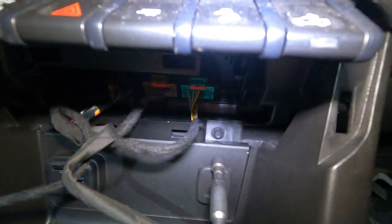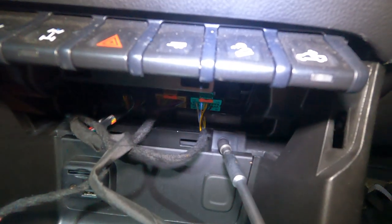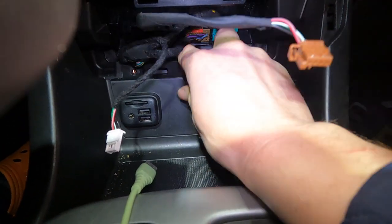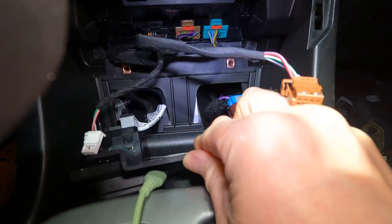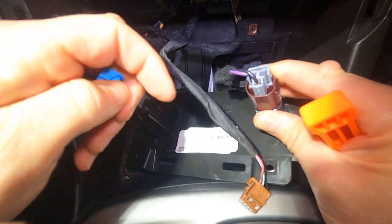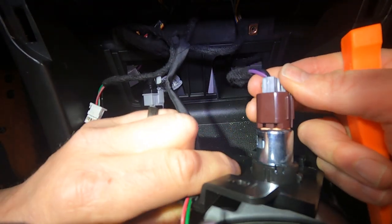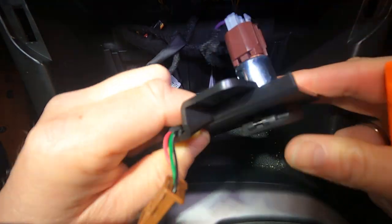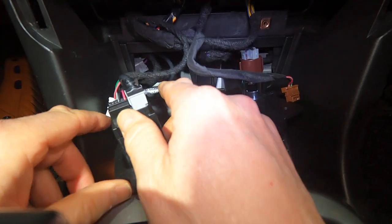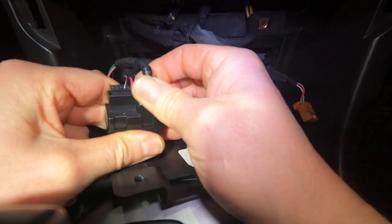Use a 7-millimeter socket to remove this little screw — be sure to save it, put it in a zip-lock bag. Then pop off this little plastic piece, which contains the cigarette lighter and the USB connector. The cigarette lighter was the bane of my existence — this was the hardest thing in this whole entire project. I'm going to show you how I did it. Up next is to remove the plugs for the USB part of this panel.